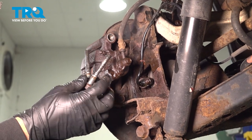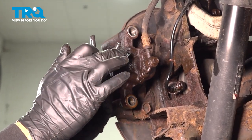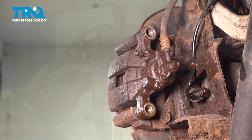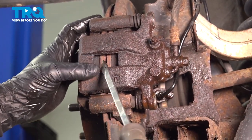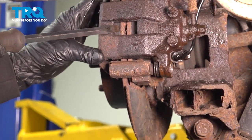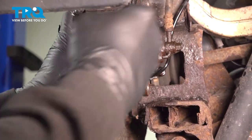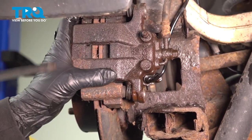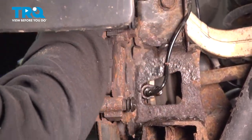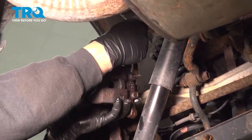When we remove our pins here, the upper pin has a little sleeve on it — I want to make sure that goes back in the top. I'm going to use a flat-headed screwdriver or a small pry bar to gently put some sideward pressure here. This is going to compress that piston just a little bit on our caliper, which will allow us to slide this off. I'm going to use a tool to support and hang this caliper up and out of the way.